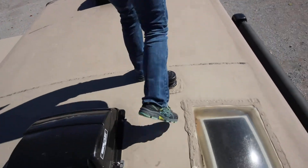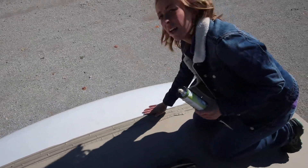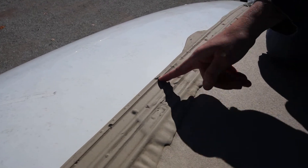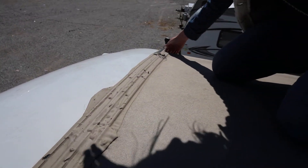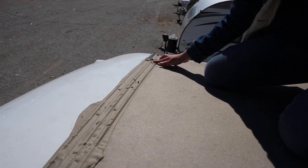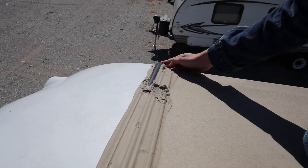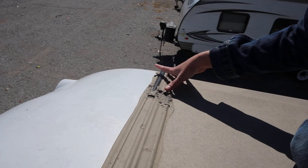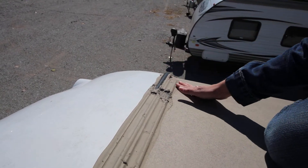Let's go down to the nose of the camper. This is another area that's really important to check — the end and the nose. As you can see, this one needs some maintenance; it's got a couple of little cutouts here and right here it's really exposed. This is a little trickier. If you're getting close to the edge of your camper where the lap sealant could maybe slide down, we usually recommend you use caulk instead, just to make sure you don't have any drips go down the side.